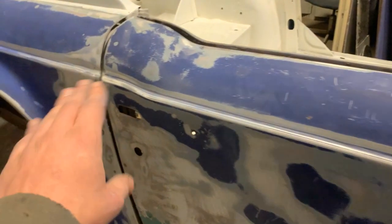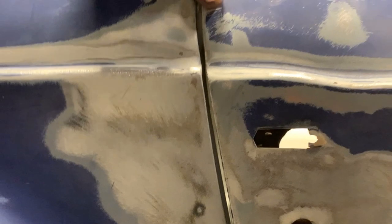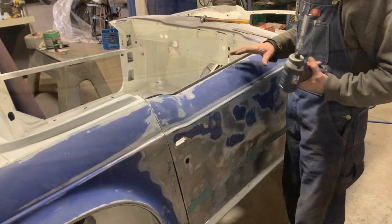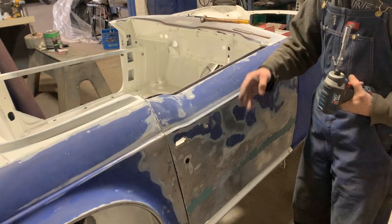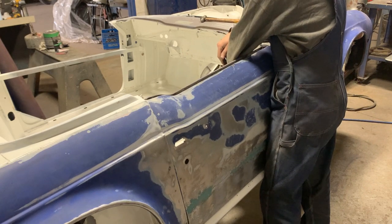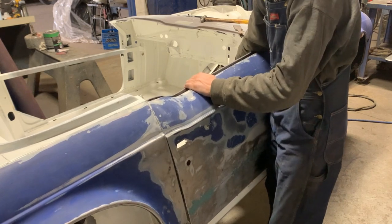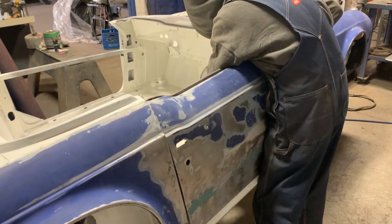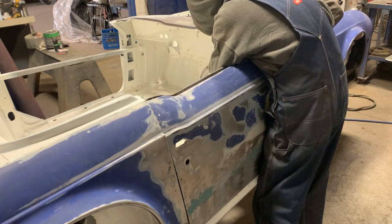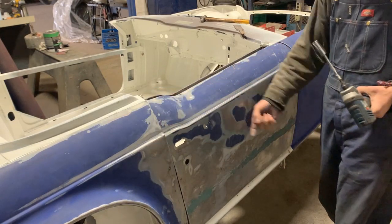So what we're gonna do is we're gonna loosen the top hinge first, we're gonna move it backwards, we're gonna tighten it, then we're gonna loosen the bottom hinge, we're gonna move it backwards, and we're gonna tighten it. And we're gonna try to keep this here leveled, which it's not anymore. Somehow it dropped. Anyway, so let's try to do that. Because of the weight of the door, I don't even need to drop it. I'm just gonna loosen the top hinge and it's gonna drop down automatically. So you see, it's down already. Okay, and now let's loosen the bottom end and lift the rear end up.